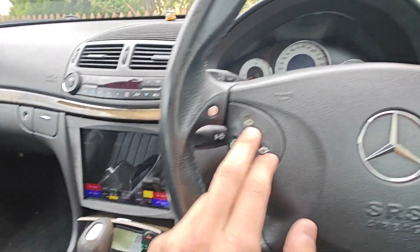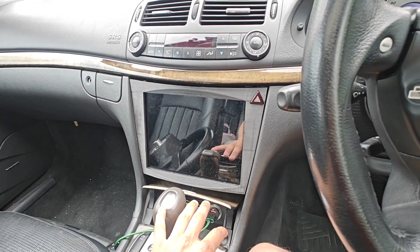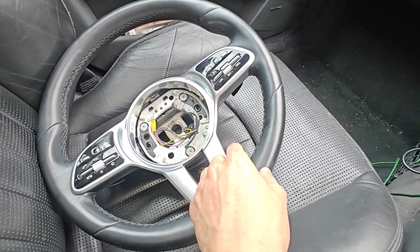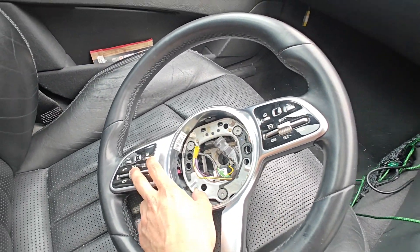For now, the PC has only been able to use these two buttons here, and it's a bit limited, especially when we have so many functions I want to add to this. So I bought a 213 steering wheel, and here is MB-Link's steering wheel adapter, which they've added some custom code on for my PC to interact with via custom CAN frames, so that I should be able to make use of all these buttons.